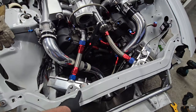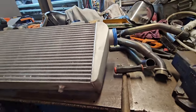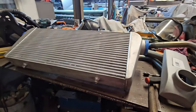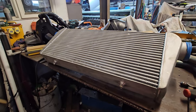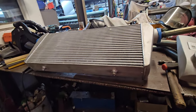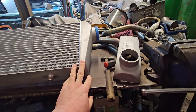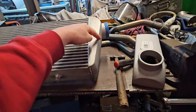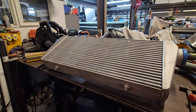Down at James's again - going to cut one of these end tanks. I've got a replacement end tank from Turbo Zentrum. We're going to cut this in half so I have two inputs and two outputs. I'm not sure if it's going to favour one side over the other, but there's enough data logging on the car to find out. I wanted to run cast end tanks rather than fabricated folded ones, because with the throttle body position on the supercharged car it's quite aggressive when it closes. We've split fabricated tanks a few times, so hopefully cast tanks will resolve that.